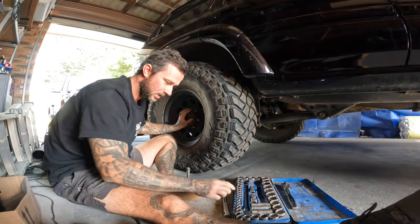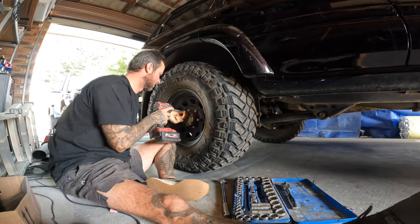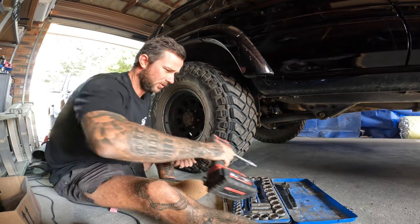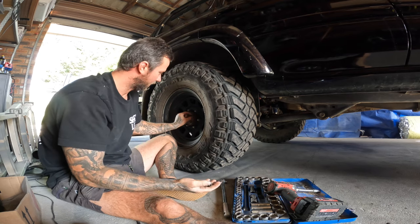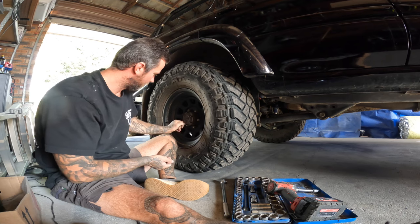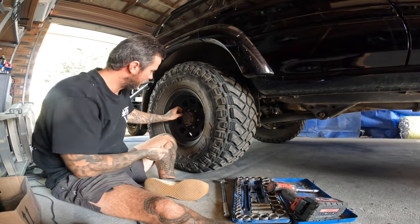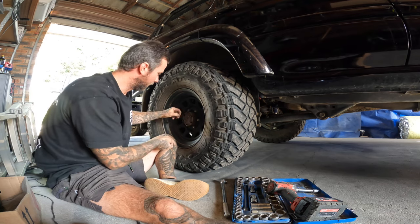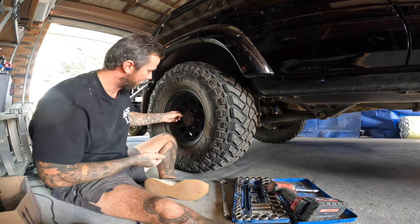I'm going to go loosen these here. So this is your rear axle. I've got to do a full service on this car anyway — it's due for a service. When I was out the other day I got some spares of these because sometimes they can be a bit of a pain. You've got your nut, and then there's a washer, and then there's a cone washer. The cone is sometimes a bit of a proof to get out, and if you damage one you'll never get the nut back on, so they're handy just to have spares.